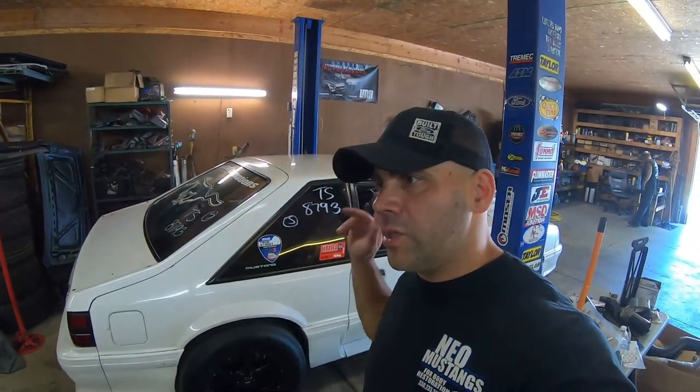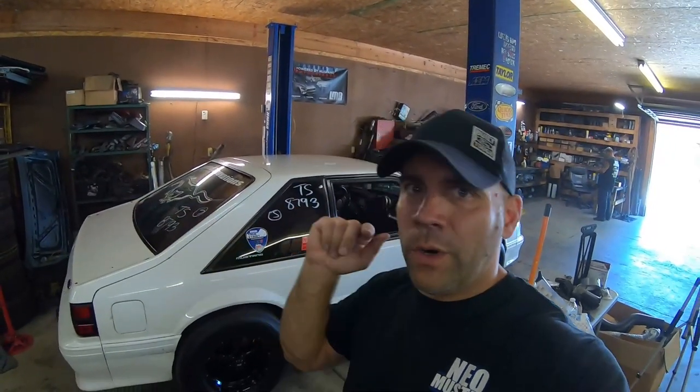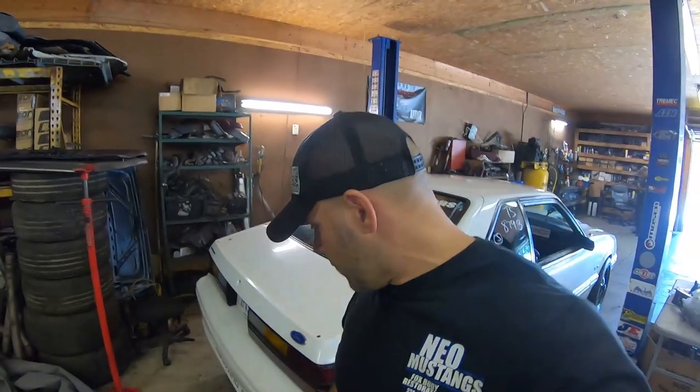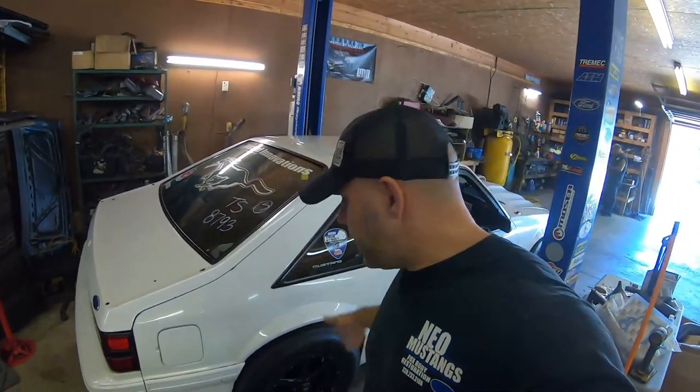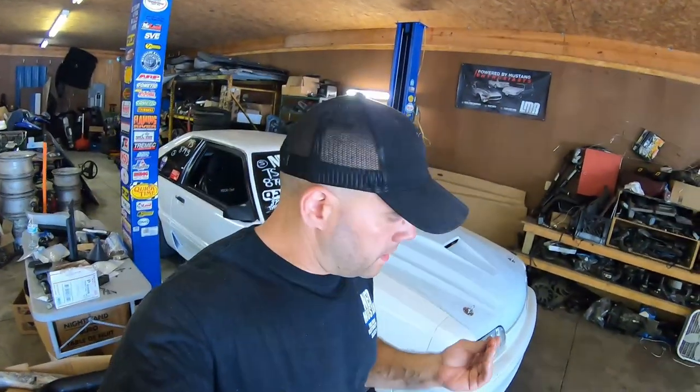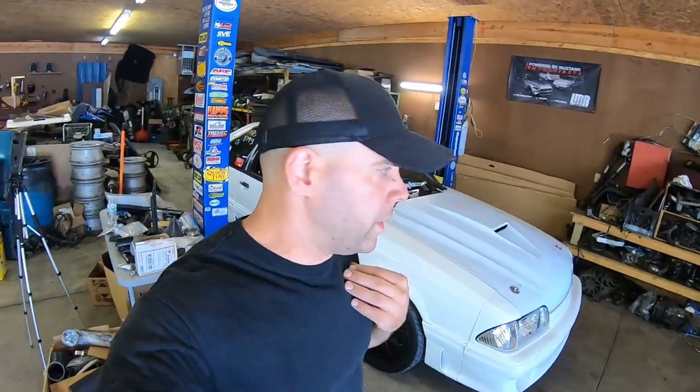Did it bend? All right, YouTube, that's about all I have for you today. We got everything back together, everything's tight. We ended up just taking one of the control arm bolts and feeding it into where the old control arm bolt is and it just taps it right out, which is perfect. So we cleaned up some of the area under there, checked everything else out, checked the torque on everything, and I think I'm pretty safe right now. But we are about to hit the track because it is a Wednesday, and I'm gonna cut this video off.